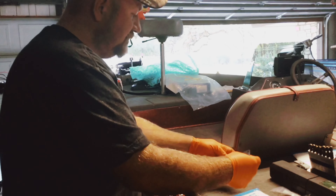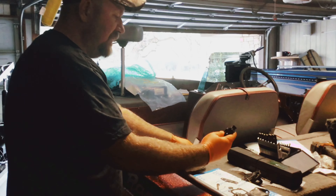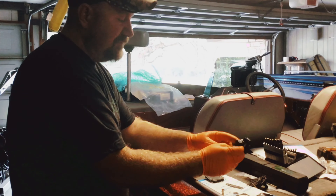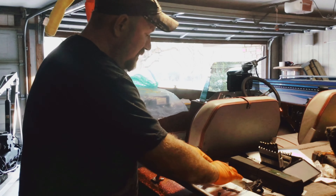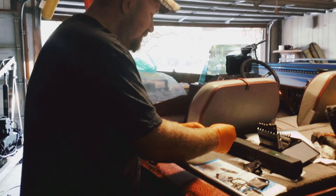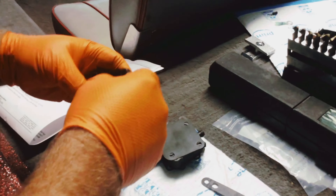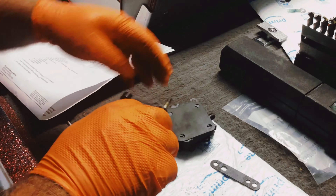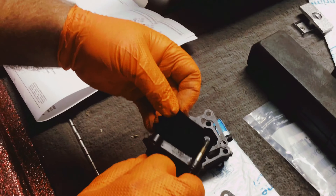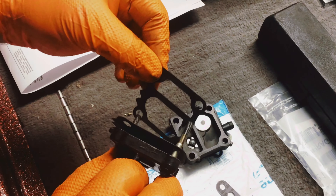We lined up the plate and the rubber diaphragm along with the gasket, and then I've got the inner portion with the valves and the spring plunger installed. We'll put it together — it's kind of a sandwich operation here with the new parts. The easiest way I've found is to get everything lined up on the bolts in the order that they go in.